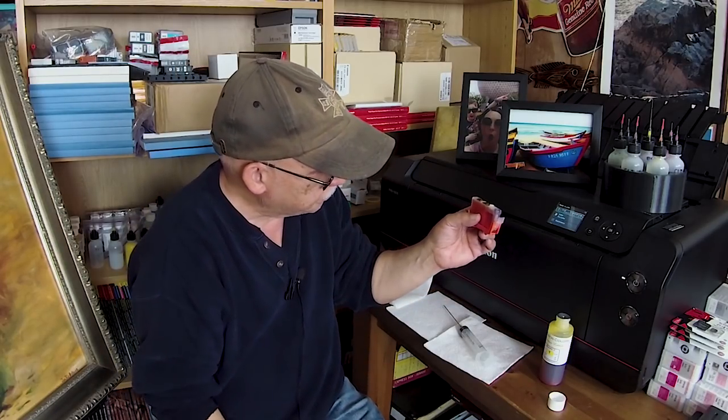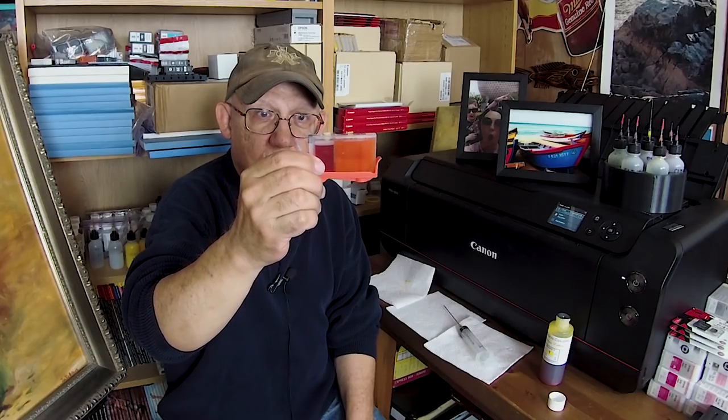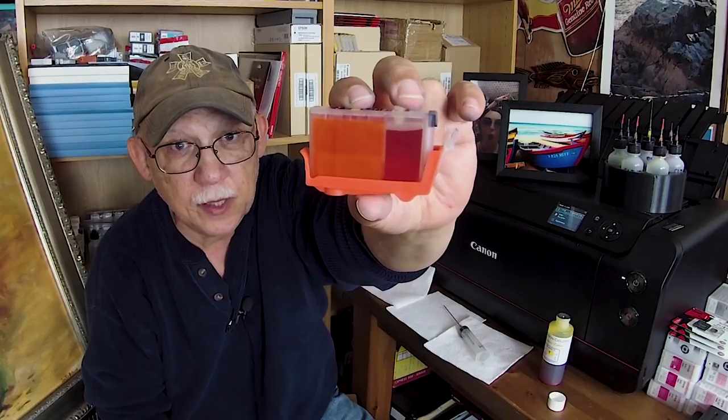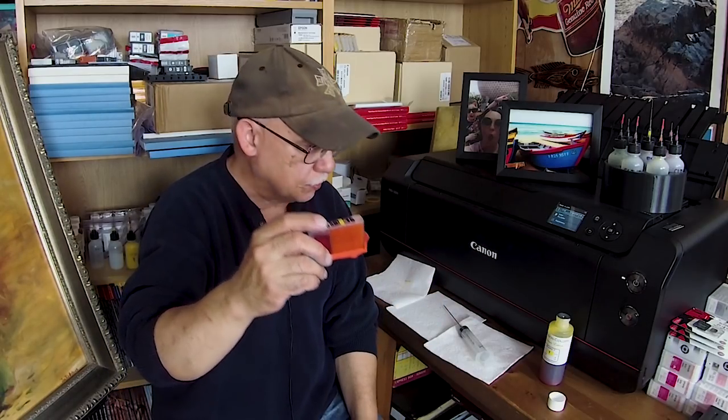I did that the other day while they were still drying. Wait a few minutes and just take your time — if the ink level drops, that means the sponge had not reached the proper saturation level yet. Notice there are no white spots anywhere on the sponge — properly saturated. You can clearly see the lower and upper half of the sponge have two different densities. This is a highly engineered sponge that produces the perfect ink flow for the finicky and rather delicate thermal printheads that Canon printers use. So this cartridge is done and ready to be used.